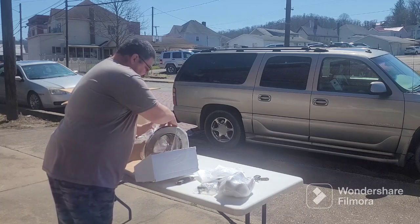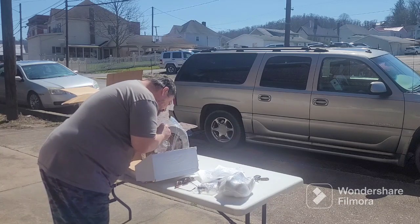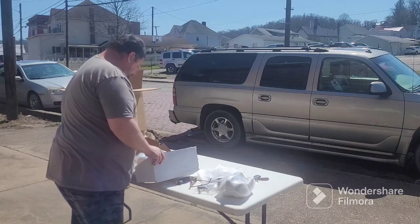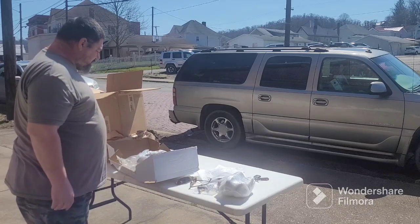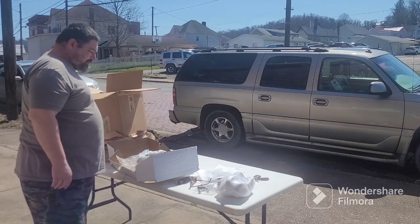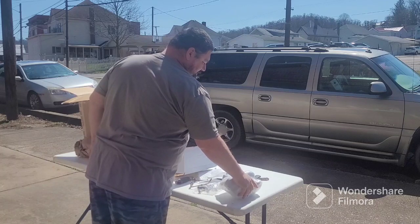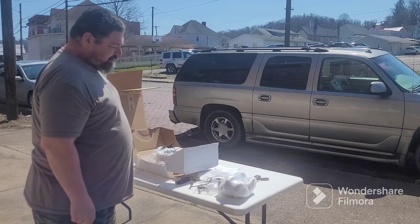There's a minimum thickness marking on it. And it's got part numbers on it. So once I get somewhere that has internet service, I'll be able to look up that rotor. Before I put all this away I'll take a picture of it after I shut the phone off. The caliper and the bracket will have casting numbers on them and you can look that up online.